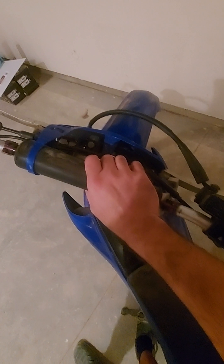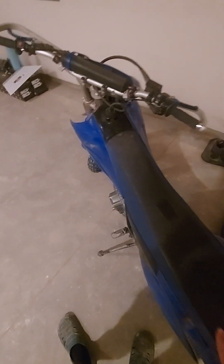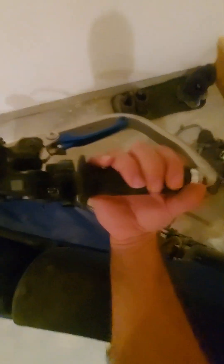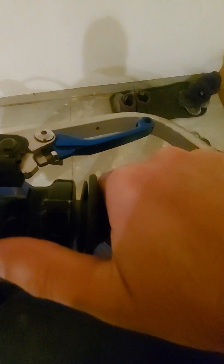To kill the bike, hit the kill switch right there. And that's essentially it. Now to start the bike — keep in mind they are carbureted. As long as you're on neutral, sometimes you have to give it a little gas to start. You don't want to give it a handful of gas — just a hairline. Look how much throttle I give it. Just that little hairline.